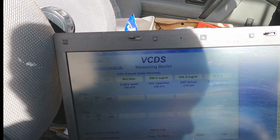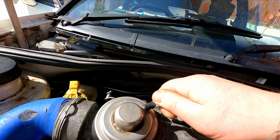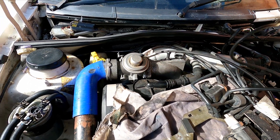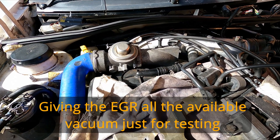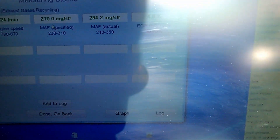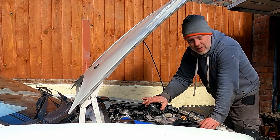Just as it's starting to warm up — it's chopped up ever so slightly, let's give it a blip. There seems to be a vacuum line issue there. I'll run one of the pipes straight from the actual engine to the servo so it's always got a direct feed — see if that alters things. We can actually see that the EGR reading's gone down.